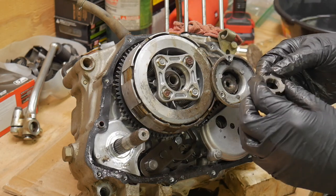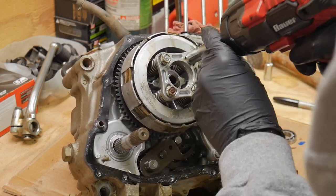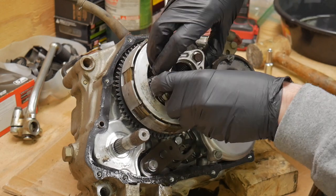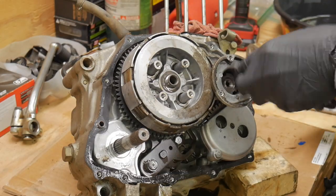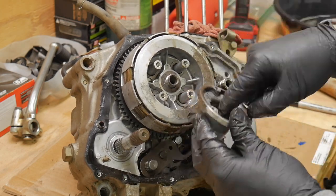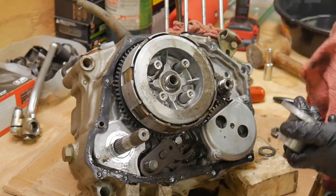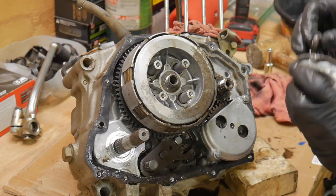I want to also double check the orientation of that nut. There's all kinds of conspiracy about which ways these lock nuts go on these old bikes, and as you saw, this motor's never been into this far, as I would know, and the rounded part faced down towards the motor. Look at the corrosion on the face of that hub. Delicious. Alright, we'll pull this off fully. There is a washer behind that. It's probably orientated with an outside marking, like a beveled washer. Like a lock washer, in other words.